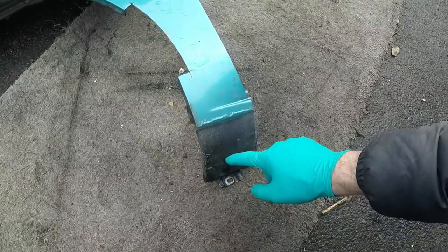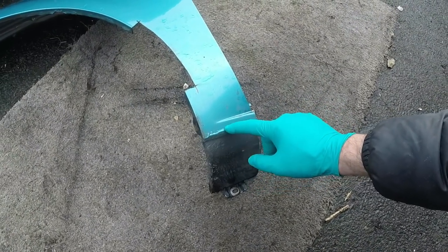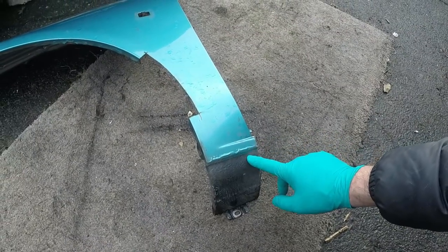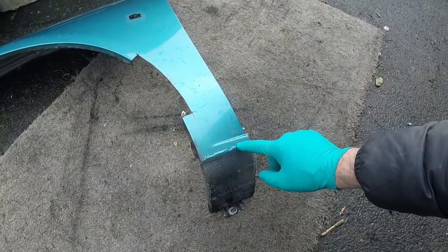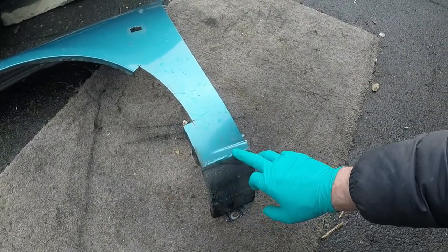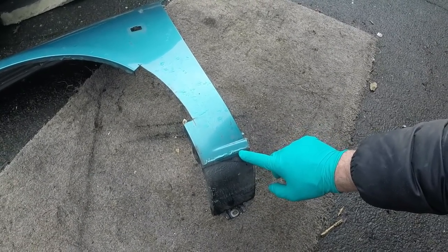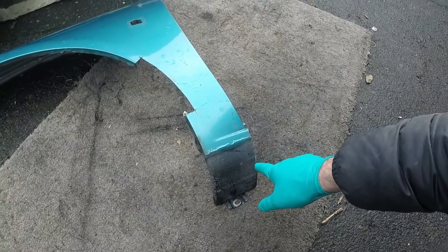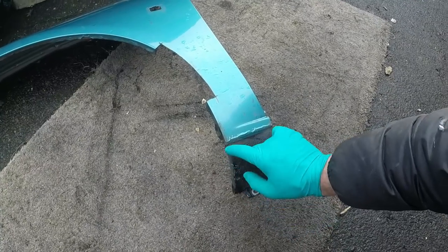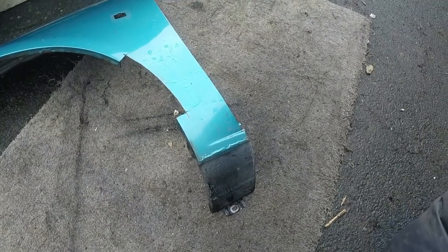Here's the old wing and you can see the stone chipping comes right up onto the bottom of that bit where I've made my horrible welded joint. So I'm going to ask the body shop if they can replicate that - they can put filler in, do all that nicely, and then the bad welds I put in won't need to be ground down anymore. They can just be coated over. So I'm going to chop that bit off, bolt that back on the car and then put epoxy on everything below that line. Then it should be ready for the body shop - at least this side will be.